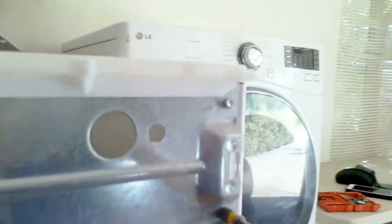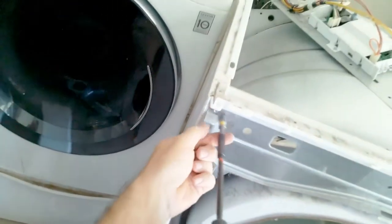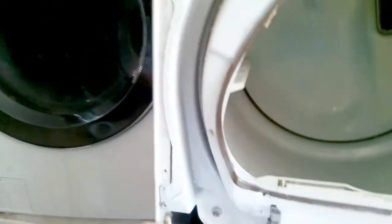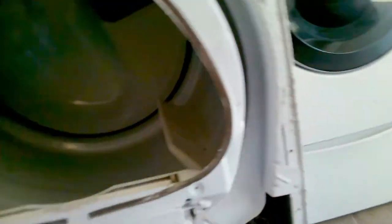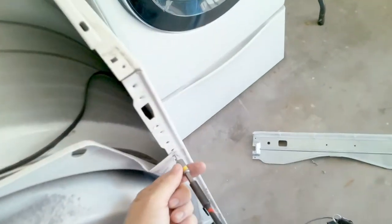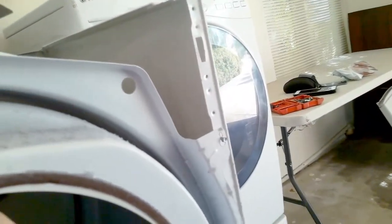Now we're going to remove the top housing. There are two screws on the right and two on the left. There are two screws that hold this frame into place — remove the two bottom ones first, and on the top just pull, leaving those screws out just a hair. When you disconnect or reconnect the panel, it will give you something to connect the frame to without having to hold it. Then just lift straight up and pull out.